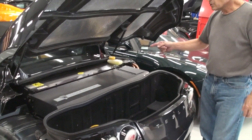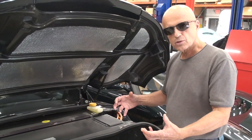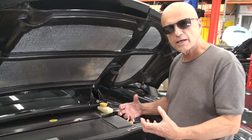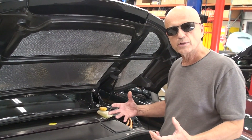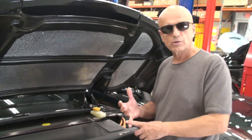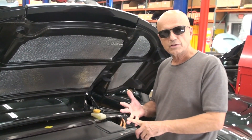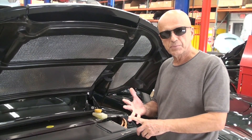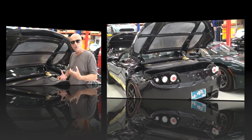What we're going to do today is open up this PEM, take it out, and completely rebuild the inside of this power electronics module, because it's full of electronic components that deteriorate with age — things like electrolytic capacitors, filters that dry up, relays, contactors that eventually get pitted and wear out. We'll also change a bunch of other wear-related components.